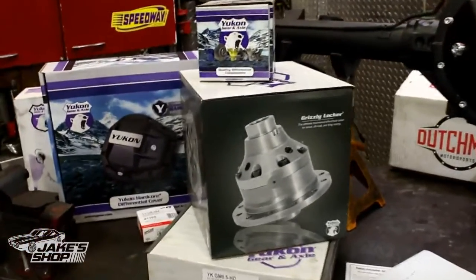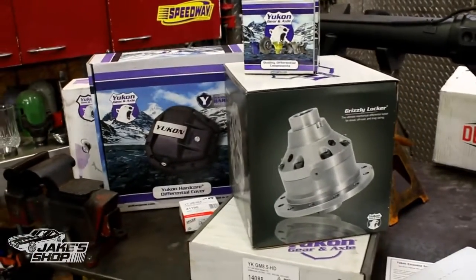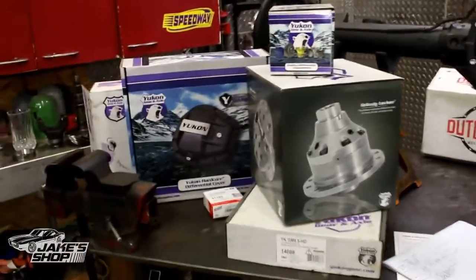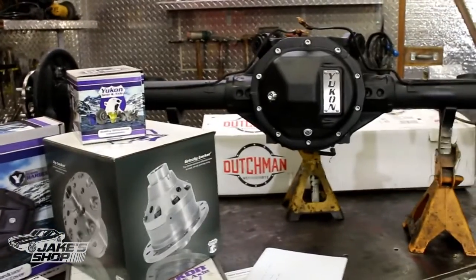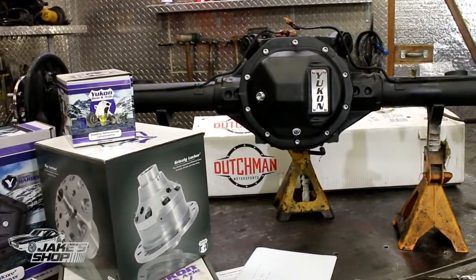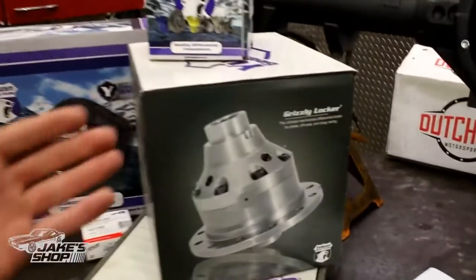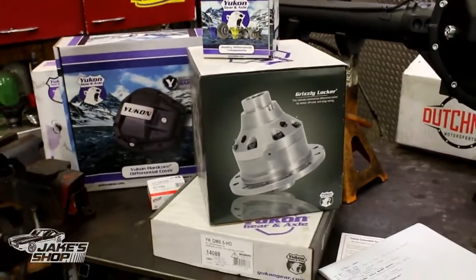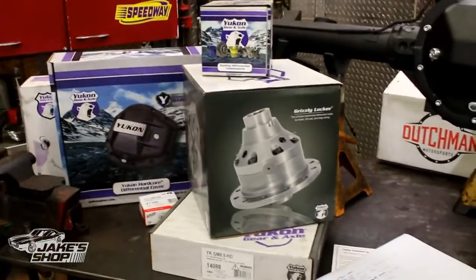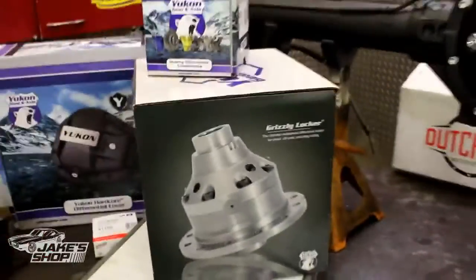There's so many different types of stuff out there. I called Randy's Worldwide up and they've always done an excellent job of helping DIYers actually do it themselves. What I wanted in this axle was new gearing — that was key. The gearing in this thing was 2.56 and this car did not deserve gearing like that. Also, what kind of differential? There's a bunch of different types — you can run completely open differentials, which is no good for a muscle car; you can run limited slip style differentials; or a locker style differential, which is more of a locking mechanism that goes in there with springs. This is a patented design that Yukon makes.